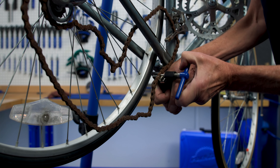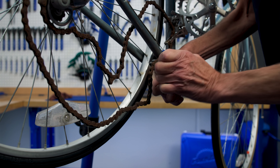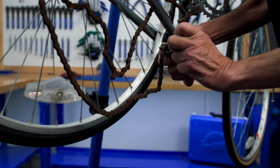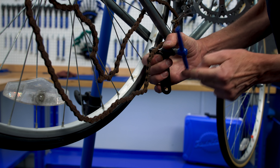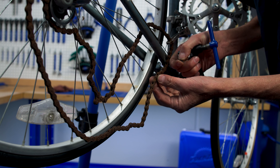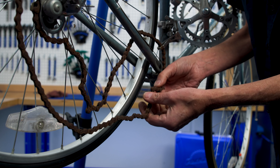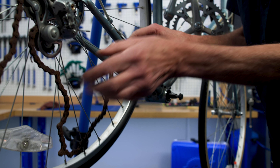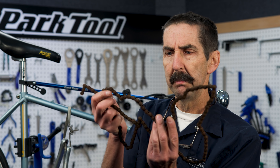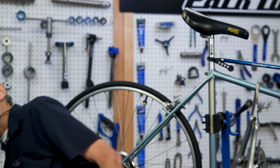Just what we expected — that is a lot of force to drive that out. This is rust, obviously, on this chain. But what is rust? This isn't what we would call surface rust — that's just aesthetic. We have some good old structural rust here. This rust has eaten into the surface of the material, so this is going to be a weaker chain. There's so much friction in there, no way can we salvage this. Except possibly it could be a nice piece of art — or we could mount it to a piece of driftwood in the form of a bike as a trophy for somebody's race. Maybe we'll save that for later, a little artwork for Truman or something.